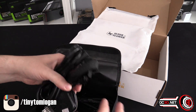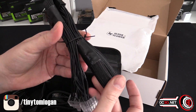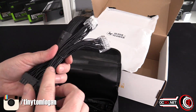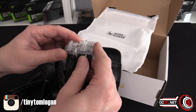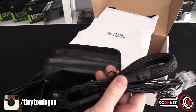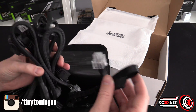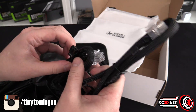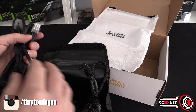Inside the packaging, they're all black cables, partially braided. I say partially braided because you do get some fairly big ends that come off the ends. The only thing that really changes with them this time: you get six eighters rather than ten, and you don't get a second eight pin CPU power. You get a four plus four, but you don't get a dedicated eight pin now. So you don't get a secondary one. That's with the 650W — you'll get more cables with the higher end ones.